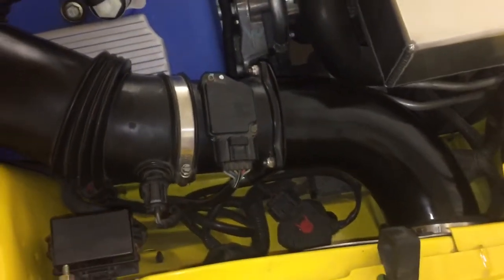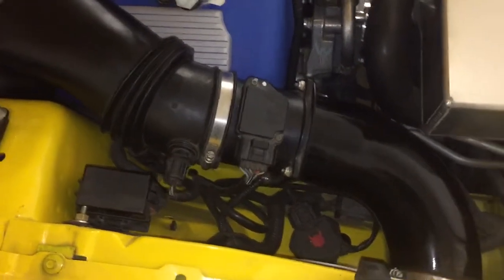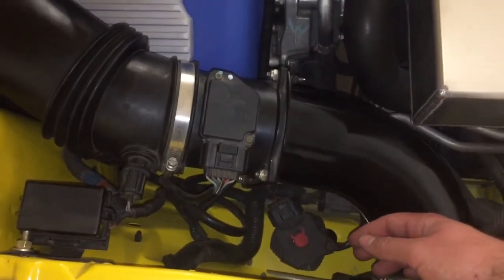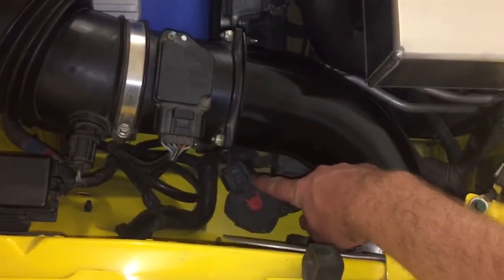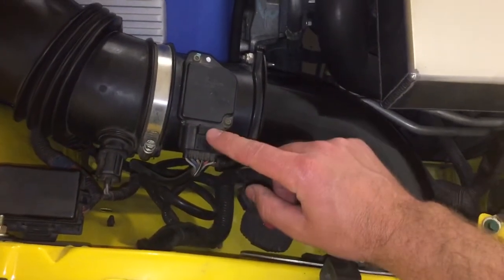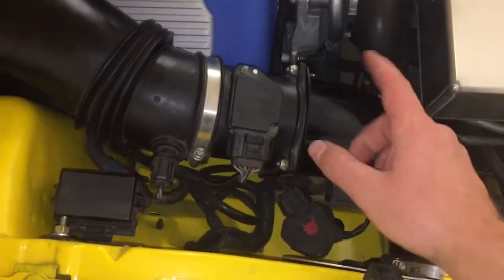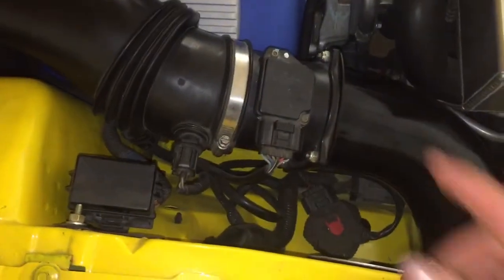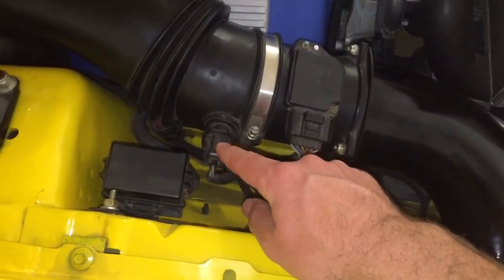Right here is the mass airflow meter, or MAF. It's measuring how much air is being drawn into the engine, which helps the engine make changes with fuel so it can run smoothly and know how much air — and therefore how much fuel — to add. This car has a MAF extension that plugs in here and allows the car to read a higher amount of airflow, because with an aftermarket blower it will peg the system pretty quickly.